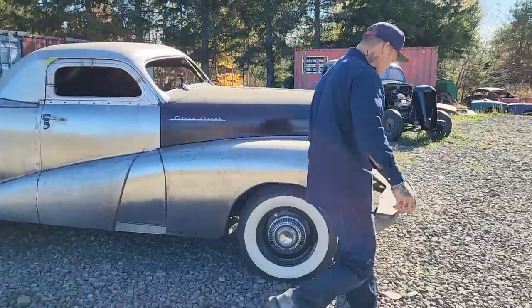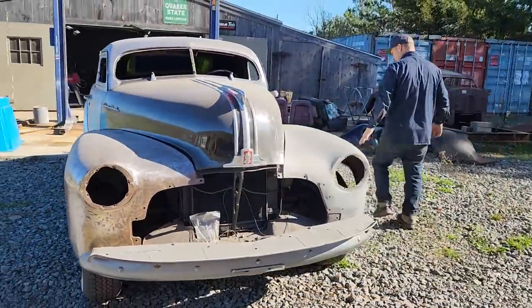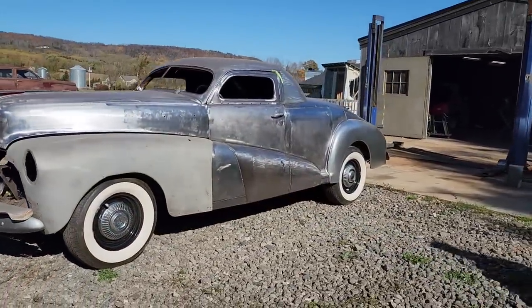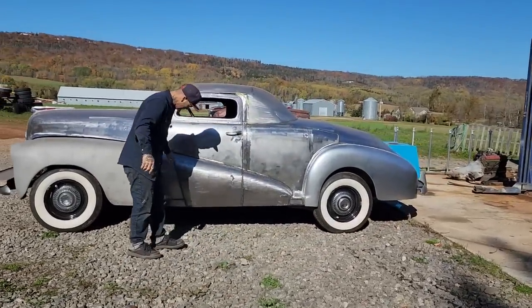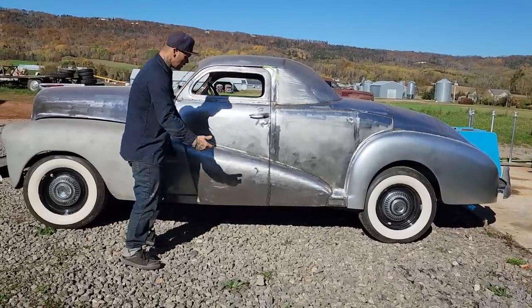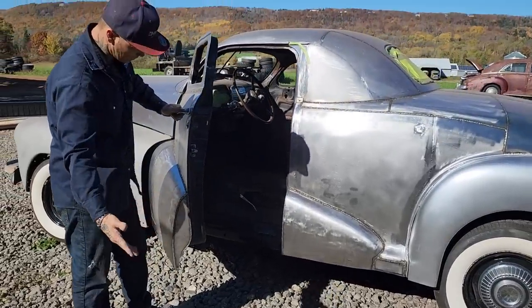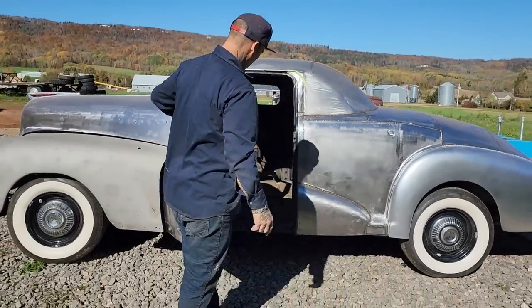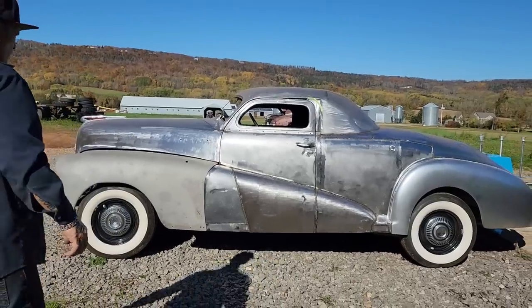Let's go to the other side. This pan is going to have to be changed because the fenders that we're using are not the fenders that were on the car. We've got this side looking decent. We've got the door cut open. I've got the pieces welded on — I actually spent some time got this welded up. Jolene helped me do that. We split that, pried that out, got it as straight as possible. We've got the pods welded on this side, we've got the pods welded on that side — or fades, whatever you want to call them. I got the back piece repaired where the holes were in the sill. I've got the door opening all the way. It shuts nice and I have it all welded up, so I still got to weld up the other side yet.